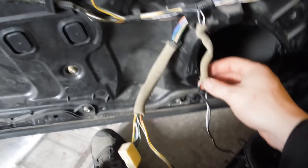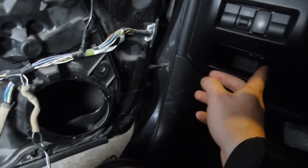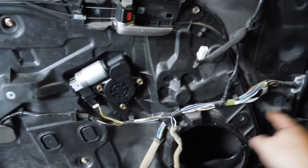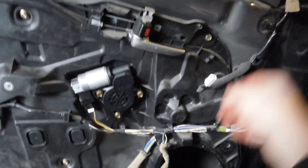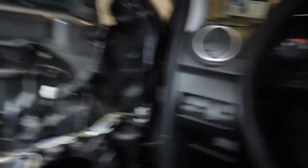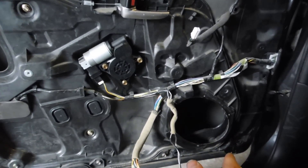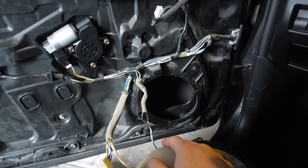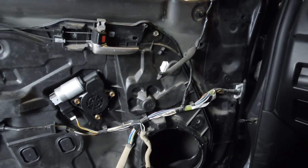What you're going to do is wire it up. As I've done here, I've got my positive and negative already hooked up. Here's the thing when you're going into factory wiring: if you're not running fresh new wire to the door, I would suggest running new wire from here to there for your tweeter and crossover — run everything fresh from the tweeter to the crossover, and from the crossover to the deck. It's just better that way. With me, I'm using the factory wiring because I've got these amped but it's nothing more than 65 watts RMS. Once you're going past 100 watts RMS, that's when you switch out your wiring.